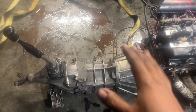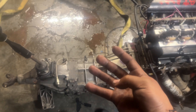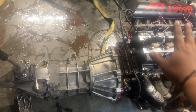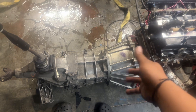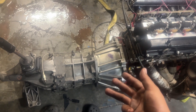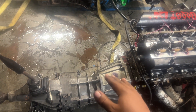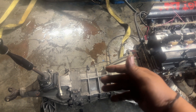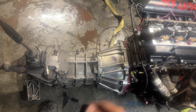If you run the R154 external clutch setup, you need the bearing retainer, the fork, the pivot point, and the slave from Drift Motion — that's a lot of money. So what I did instead is use the R154 bell housing, then get a W58 flywheel, W58 pressure plate, and an S10 clutch. The S10 clutch needs to be the fine-tooth spline — don't get the coarse one — and then it'll work just fine.